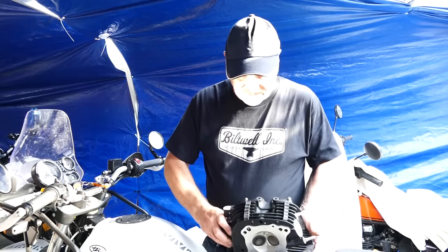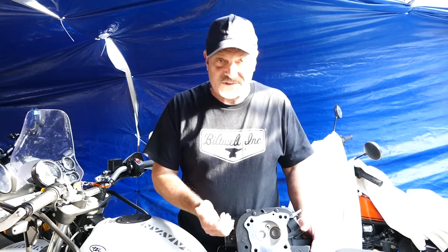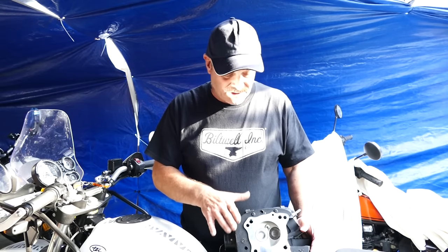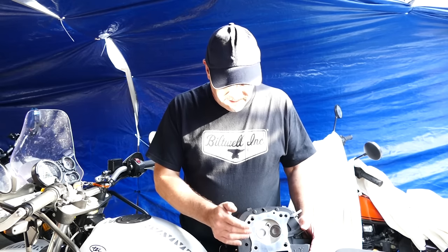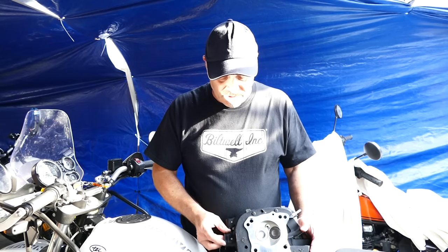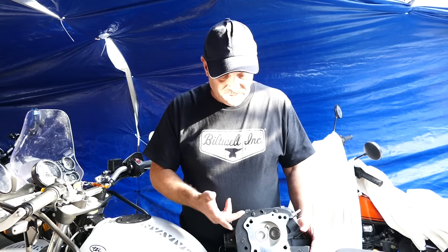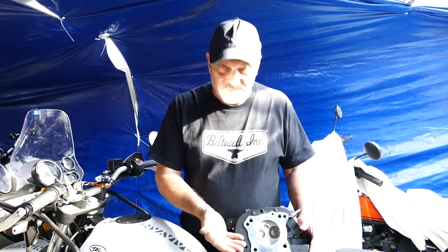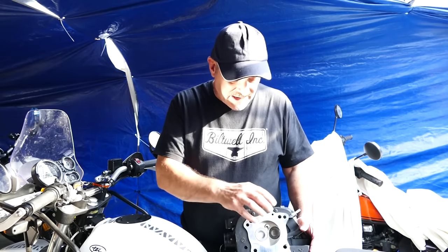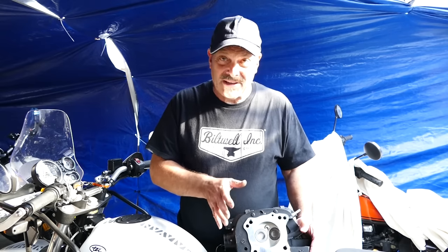So we delved into the motor to have a good look at what was going on. I've got a cylinder head off the motor here. As you can see, there's very little room to get any larger valves in without offsetting them, which again turns expensive and isn't easily done on an overhead cam motor. But the valve seat angles and shape of the ports — there is room for improvement there. We are going to eventually port this head and put it on the flow bench, because I think there's maybe one or two horsepower extra there just by cleaning up the way the factories make things, particularly around the valve seats and just underneath the inlet valve. That's the most important area of porting on a motor and that's where you can get your biggest gains.